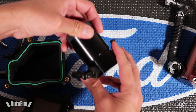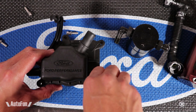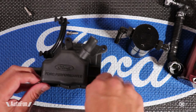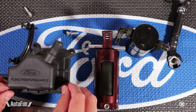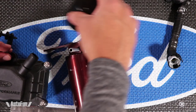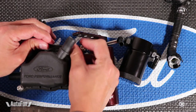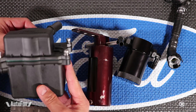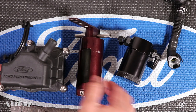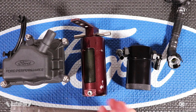Let's reassemble the Ford Performance. While the JLT can be emptied quickly, the Ford Performance takes a little longer because you have to reinstall the screws. But you get the OEM look and a very sturdy catch can that will last a long time. One thing that happened to my Bomba over time is that it lost its black color, turning into a kind of burgundy from heat exposure. The JLT has withstood the test of time and stayed nice and black. The Ford Performance is a fiberglass-type material and I don't think it will change color — though over-tightening the screws could eventually crack it. Overall, all three catch cans are built to be very long-lasting and heavy duty.